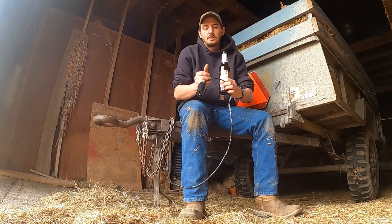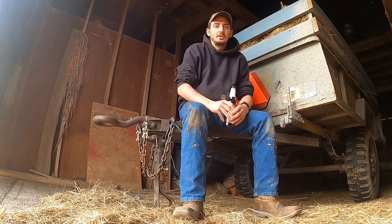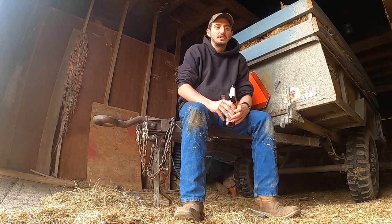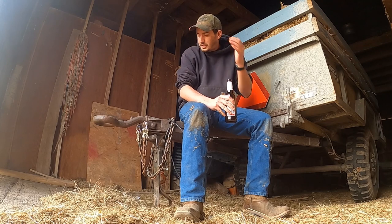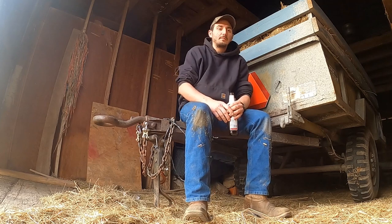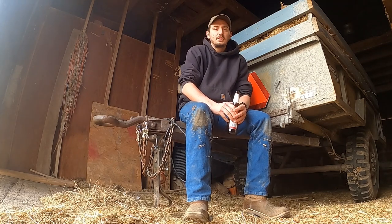And there you have it. 7-pin plug on a 4-pin harness. This is an easy repair, takes basic tools. If I had to rate it, I'd probably say maybe a 2, 3 out of 10. Definitely something that any of you guys could easily do at home. This is general procedure for if you ever had to replace a plug, even if it's a 7-wire harness, just follow the diagram and make sure you put the correct wires where they go. And it doesn't take much to get it done.